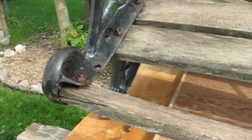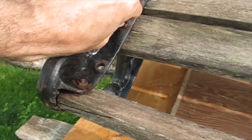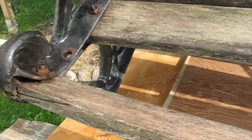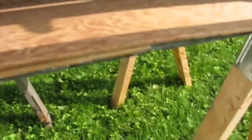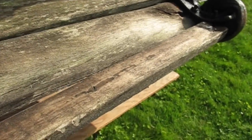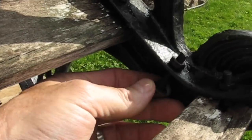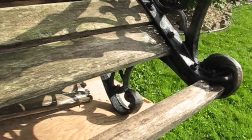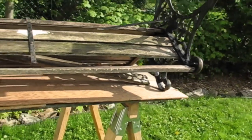After finding almost every single one of these nuts not coming off, I didn't want to just pinch them with vice grips and turn that to get it started, because I would ultimately mar those threads and then they'd never come off. So what I've decided to do is what I did with this one here on the ground — I got one side off and then the other one just tore. I thought, you know what, that's exposed, I can grip that with vice grips and then just twist it off. I'm gonna do that with all of them and hopefully this will come off much easier that way.